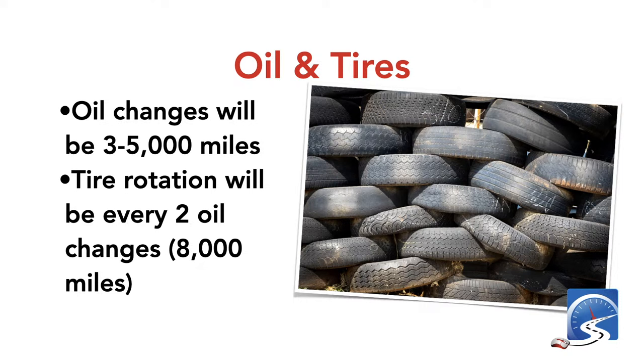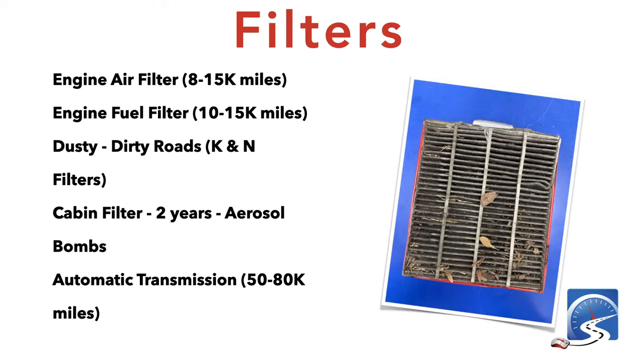Check your tires — make sure you're not down to the wear bars, and that you have good tread on them. If they are getting down to the wear bars, change them, especially for winter driving on snow and ice to ensure optimum traction. In Gavin's driving lessons, his aunt's vehicle had fairly bald tires. Even with all-wheel drive there was decent traction, but on the first day in rain, slush, and snow they were slipping and sliding because it needed new tires.